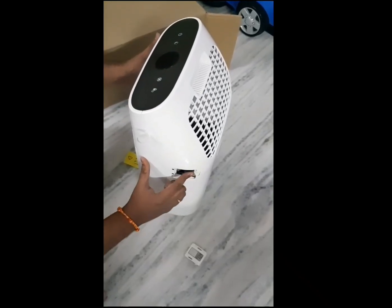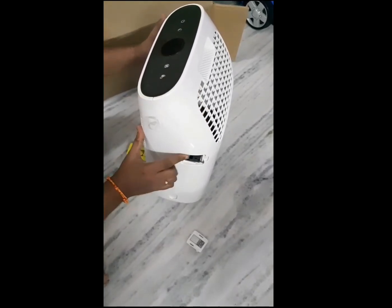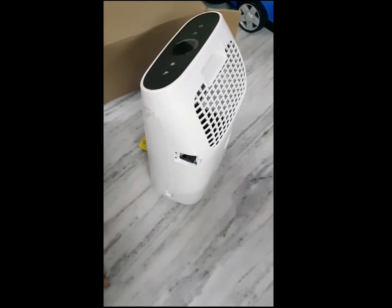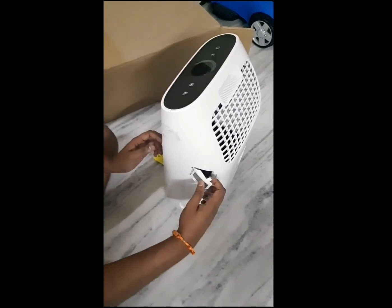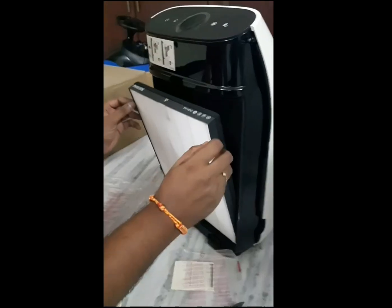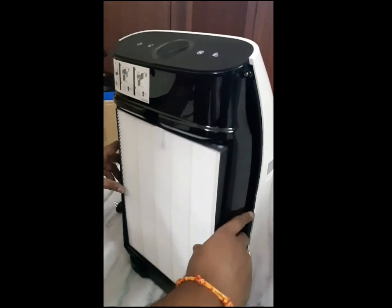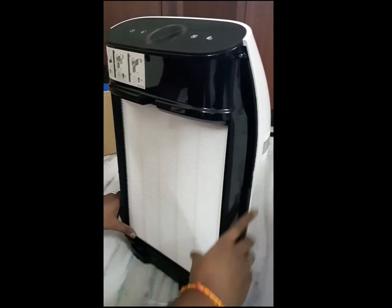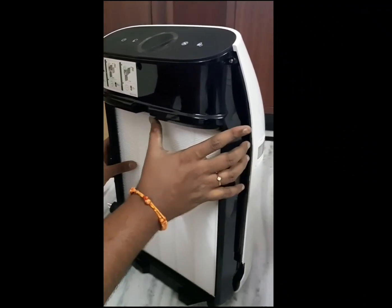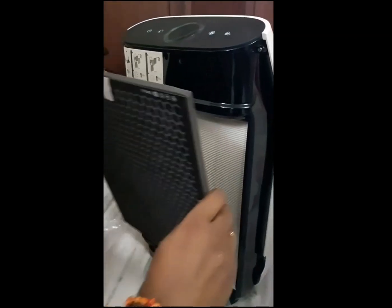And when it comes to the running cost and everything, like most air purifiers, the AC1215 requires very little power to keep it running even at full power. It's only drawing 50 watts at full power, and during its night sense operation it's drawing as little as 11 watts, which is about what an energy saving light bulb draws. And to be clear, the electricity cost of running one or two air purifiers at home is going to be only a marginal increase in your monthly electricity bill.